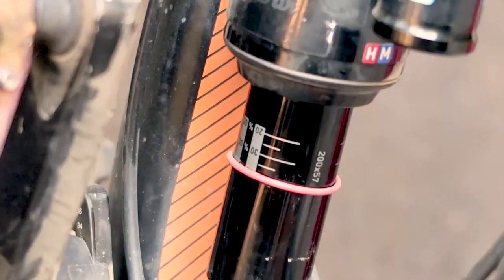A tip for remembering how to use these adjustments: dust caps are on the valves to keep dust out, but they also signal that you're not meant to be adjusting air pressure all the time. You need a tool to access it — that's a good indicator it's not for constant adjustment. Sag should be set between 25–35% for most riders; I run mine between 30–40% as a bigger guy. That's your first adjustment done.